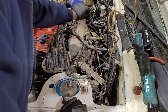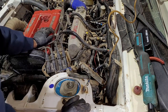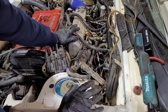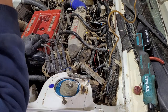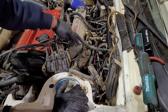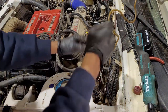There's a lot of earths that are all over the place for various bits and pieces. We're going to try and tidy that up. One of the big issues with engine management is that earthing needs to be done properly and it needs to be basically common. When the ECU gets a reference signal from all the different sensors it needs to have a common earth, because if the earths aren't both the same or aren't good earths, the ECU can get wrong readings which can cause problems.